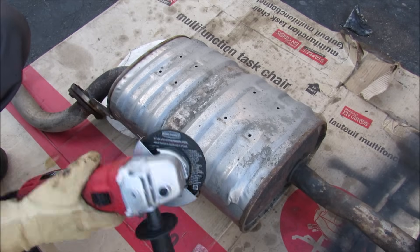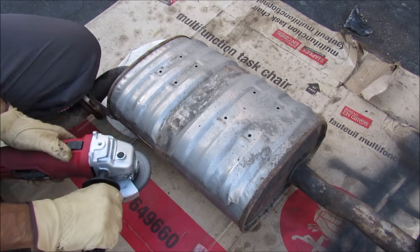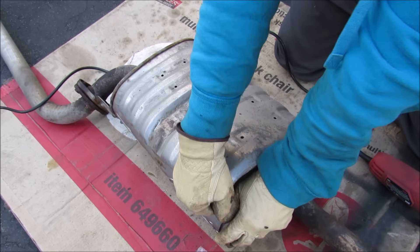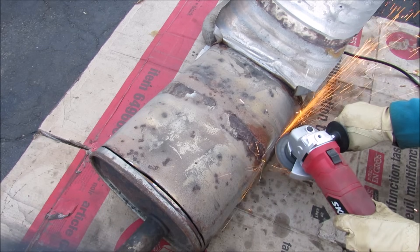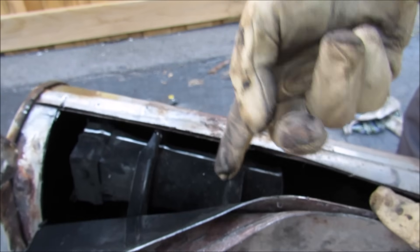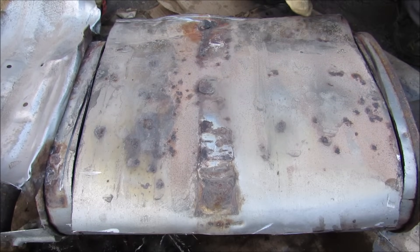Alright so I've got a brand new blade on my grinder and I'm going to grind this open to see how it works. It seems like this is a heat shield on top — I'm going to try to rip that off. Now I'm going to make an incision along the side here. You can kind of see the inside of the muffler — there's these two baffles here that are welded to the outside sheets. Instead of trying to fight those welds on the baffles I'm just going to cut it here and grind it down.